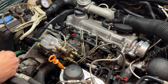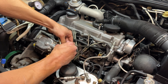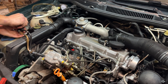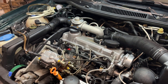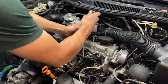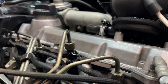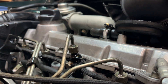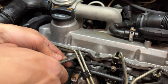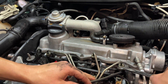At this point, we can slip our return line back on here and open that up. Very important: don't forget to take your line clamp off your return line — otherwise that causes problems. Now we're going to open up these four flare lines a quarter turn and crank the motor over, and we'll see the fuel jump out there. We've got a nice prime on those high-pressure lines. We'll snug these down — 15 foot-pounds. You can damage these lines by over-tightening them, so don't do that.